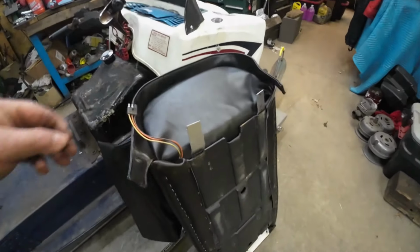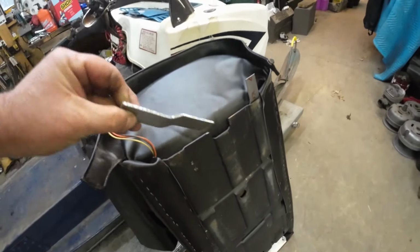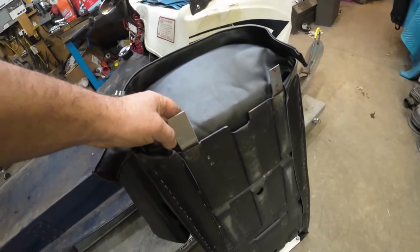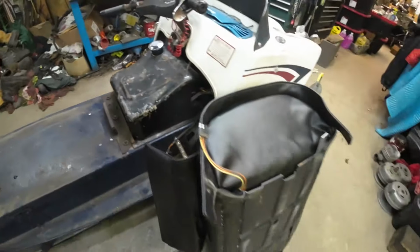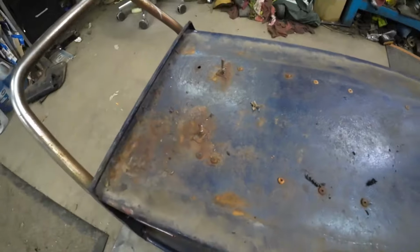All right. Here's how I attach the front of an XCR seat. So you can see how the base is. It's got these channels. I just bend up a bracket with an offset of about one material thickness. And I'll just pop rivet these down wherever they need to go and slide the seat up on those. That'll do the front. The back here, there's studs on the tunnel.